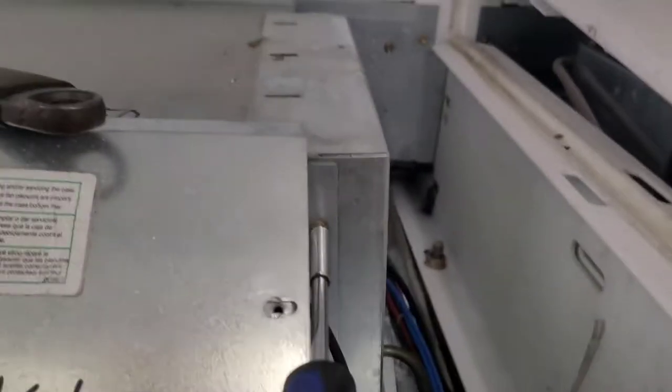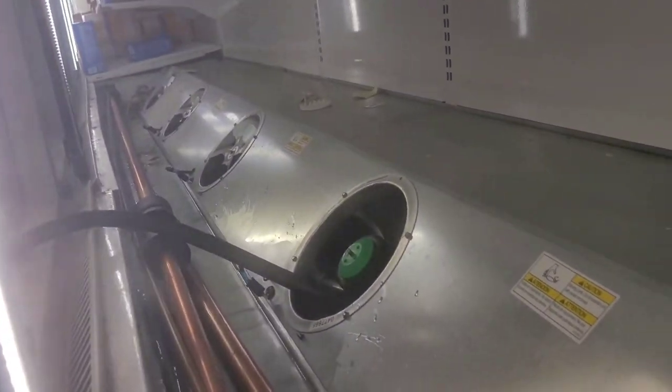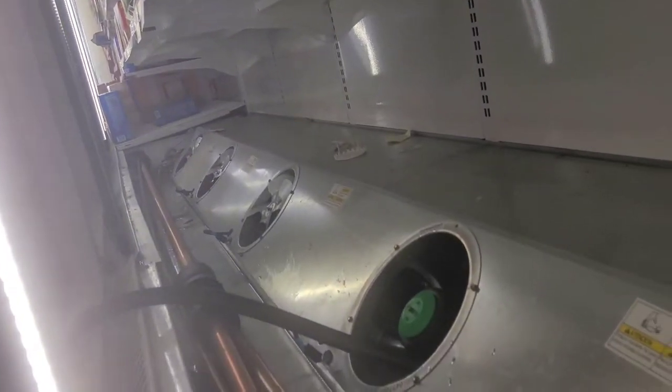I'm already taking screws out here and over there — just take all the screws out. Then once the ice that's built up at the bottom in here is gone, you can lift this fan shroud up, and then you're pretty close to being done. It takes quite a long time to melt all the ice on the inside of the fan shroud — if you don't have hot water, forget about it, it's gonna take you forever.